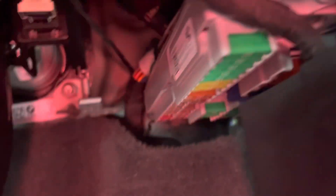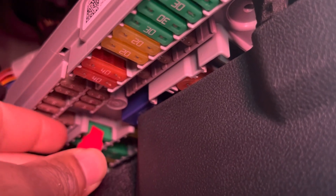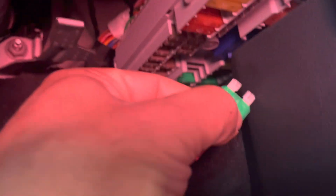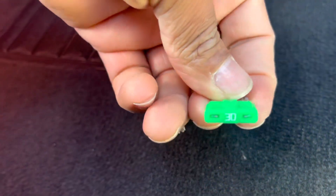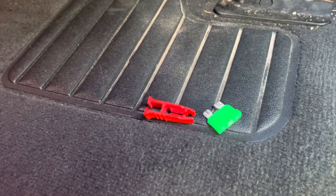Don't forget to disconnect these two wires before working, without breaking them. Fuse number 53 is at the back — yes, this one here — not the first line, not the second line, the third line. This fuse right here is a 30-amp fuse. You can use this special tool to remove it, or a pair of pliers if that's easier for you.